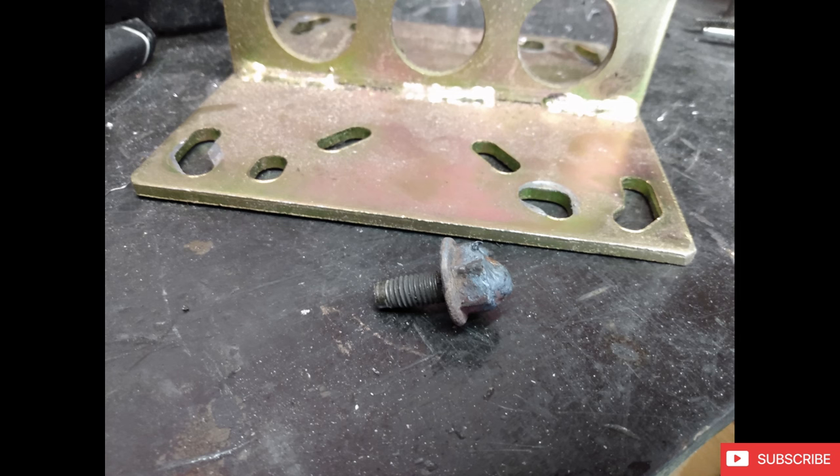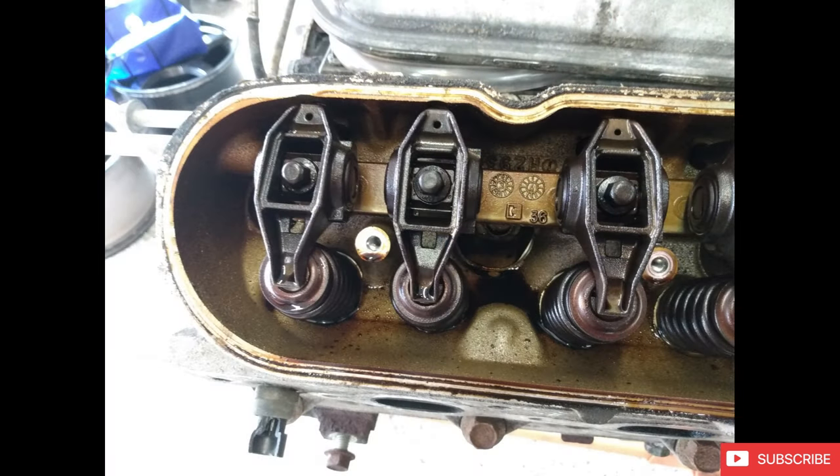So the upside was that once I got the water out of the motor, it turned over fine. I just pulled the plugs and kind of turned it over, and all the water shot out of the cylinders. I shot some WD-40 down the plug holes, and everything was great after that, in terms of just the motor turning over. The valve train looked great. It looked like this thing had decent oil changes and maintenance throughout its life. I was pretty happy about that.